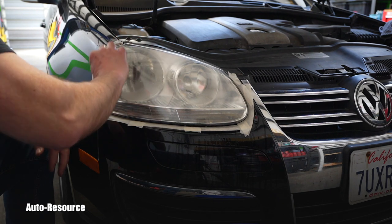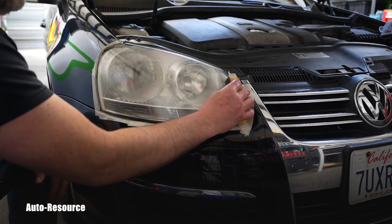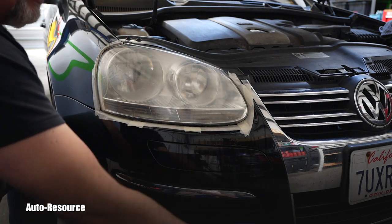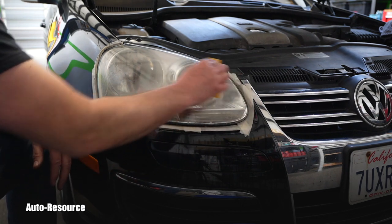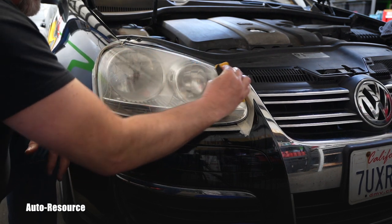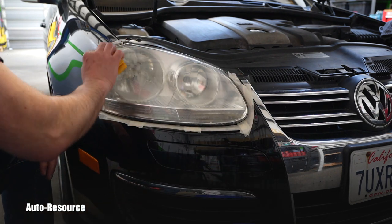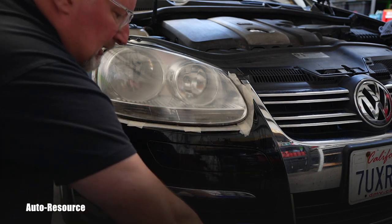Can you use 500? Yes — if you can buy 500, grab it. But that is more coarse, meaning more abrasive, so that will be the lowest grit number I will recommend. I will not personally start with 400 on plastic headlights — I think that's too rough and it might actually create scratches which we will not be able to get rid of later. When you start getting to the edges, you'll immediately realize why we put that masking tape there.